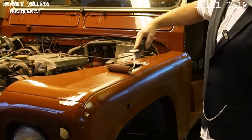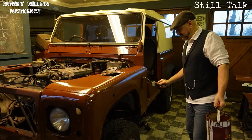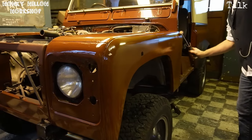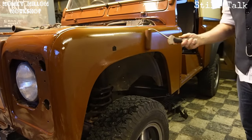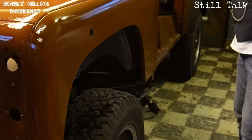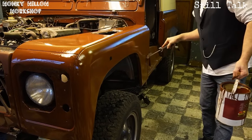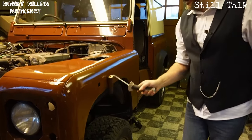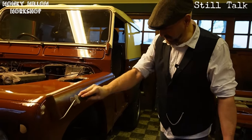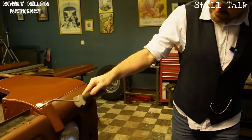At the end of the day it's an old Land Rover. The first thing you're probably going to do at some point is drive it through a hedge, and you haven't just spent a thousand pound on a paint job. I would think you probably put twice as much paint on as you would if you were spraying, but there's no great difficulty in this. It's all about getting it on, getting it smooth, before it wants to start going tacky, and then leave it alone. My old tradesman used to tell me: look after the corners and the middles will look after themselves.